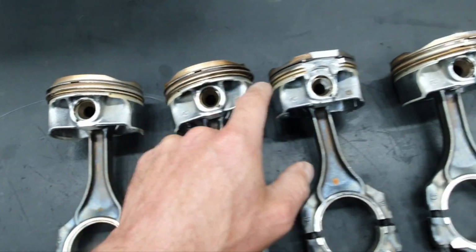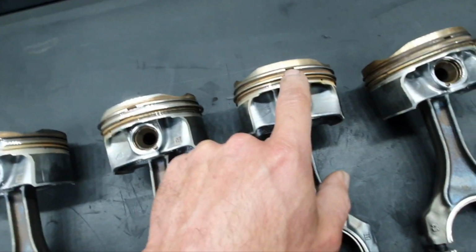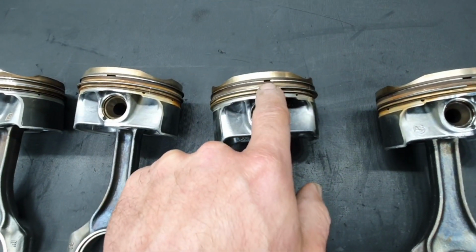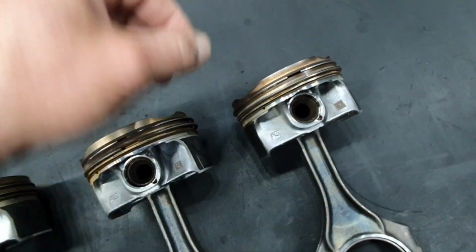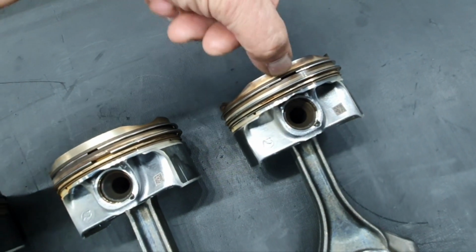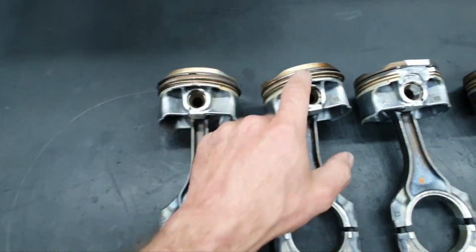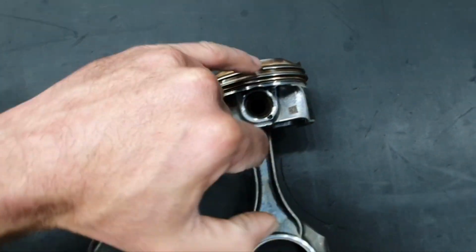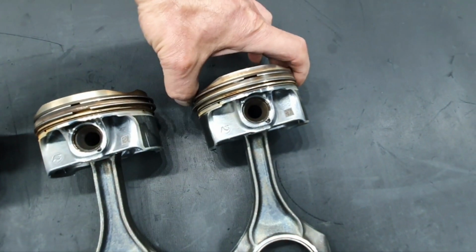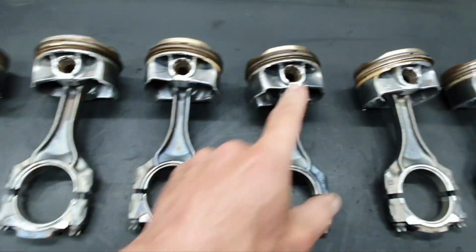No case. Forget it. Not good. Not good. Definitely not good. Okay, the gap that you see here on this piston ring on the top of the number 1, all right. To be honest, only the number 8 has the best tension on the top ring. Okay, forget the second. Now, what did I spot on the number 6?